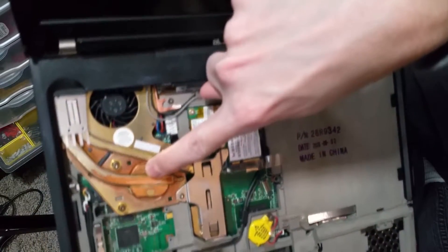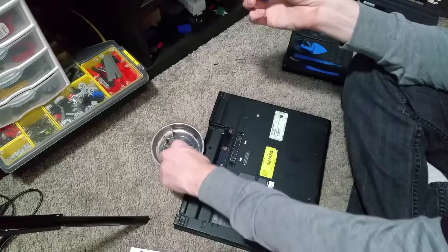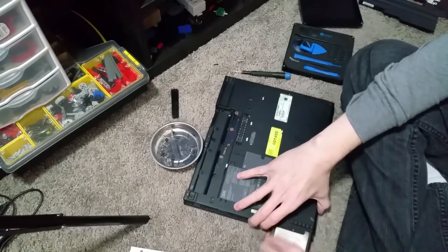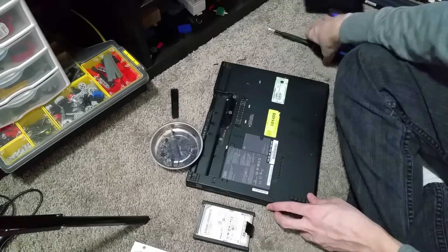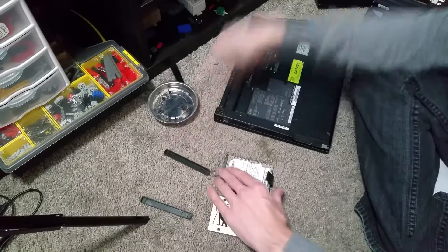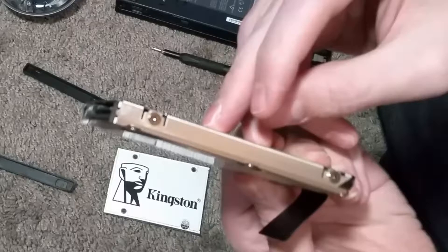The CPU is under here and the GPU is under here - it all carries the same heat sink, and I won't be able to change the CPU without taking the whole machine apart. So let's see if I can get this thing to take an SSD. There's a flap - get a hold of it and it'll let you pull it out. You want to set it down so your SATA ports are pointing the same direction, so you're just transferring parts over to the other one. This comes in a cage with two screws on either side - take those out first.